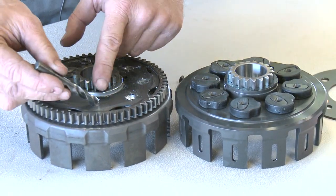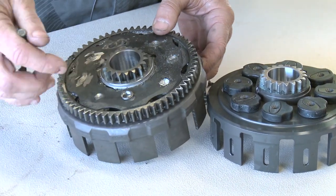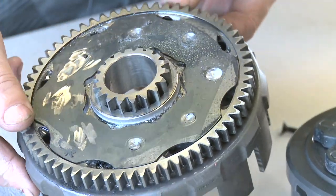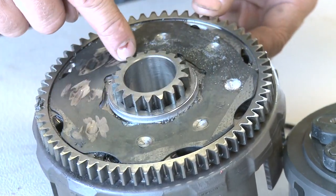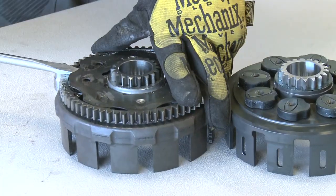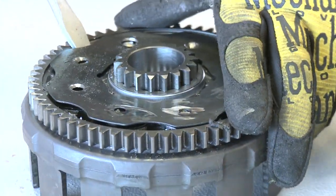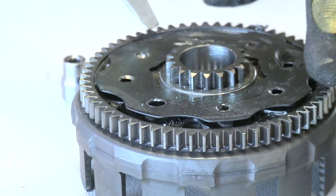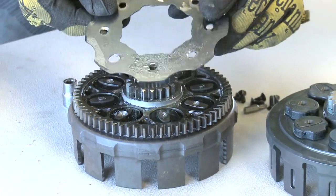For this basket you can either drill out the holes or you can grind them off. On these ones we drilled — there's the rivet head — and the ones we ground, you grind like this. When you grind, you've got to be real careful not to bump the gear because the gear actually sticks above this plate. You can ruin this plate, but it's okay because you have a new plate that Henson supplies. At this point we're going to pry off this stock backing plate — just walk around like so — and it'll pop right off if you've drilled or ground correctly.